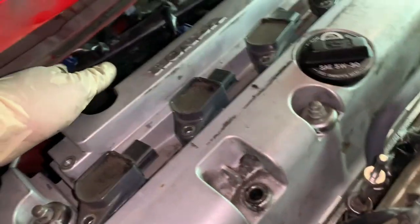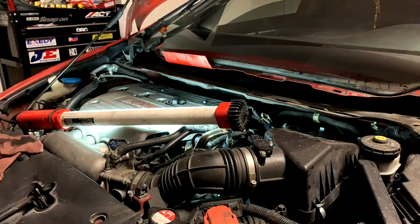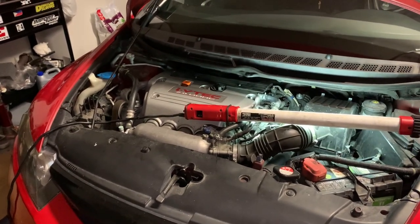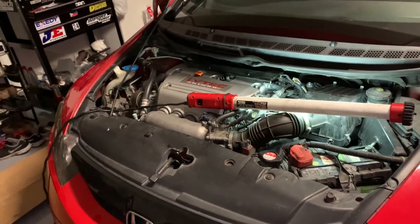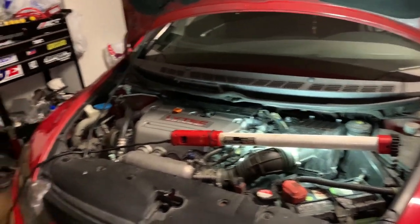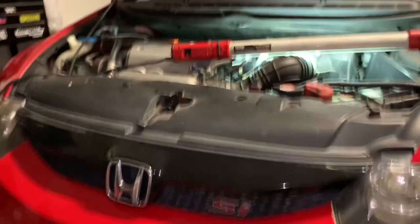Let me bring you over here real quick - just want to make sure none of the gaskets got pinched out or came out of the groove. Valve adjustments are done on this 2009 Civic SI. There was only one tight valve so I'm hoping that was the culprit causing the rich condition. I won't be able to start the car until tomorrow just to be courteous to the neighbors. The homie Lorenz has an exhaust system that sounds pretty nice.